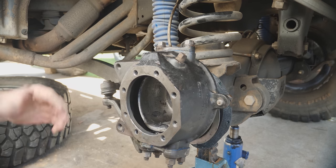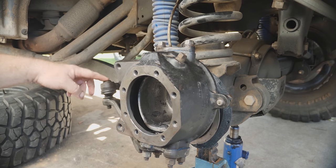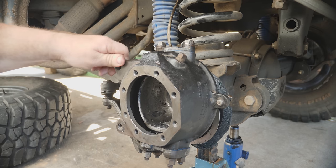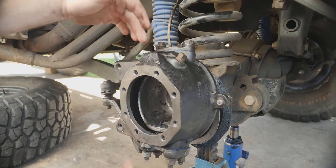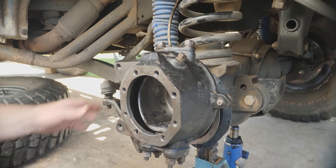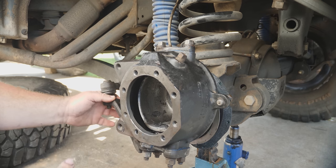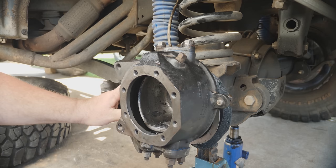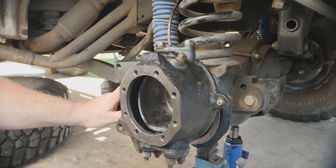The proper way to do it is to pull out your drag link and use a spring scale to assess how much drag is on the kingpin bearing. I do it by feel — I'll lift up the other wheel and make an assessment of how much preload I've got. I double-checked the by-feel method last time and it seemed to work out pretty close, so I was pretty happy with that.